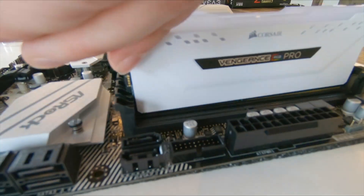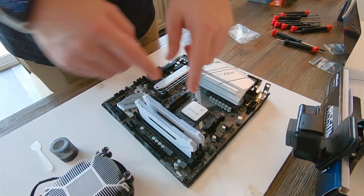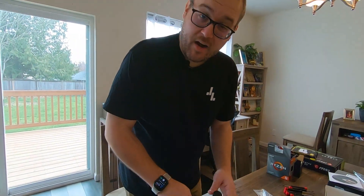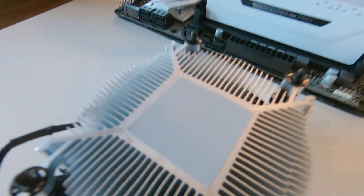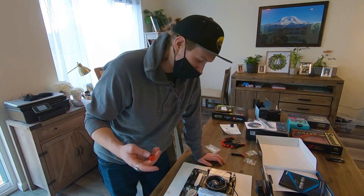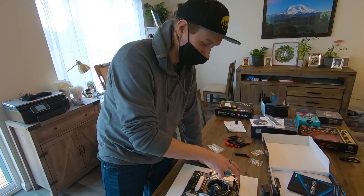The first thing we have to do is remove these two motherboard guards that line up with the screws on our heat sink. Then we're going to apply a little extra thermal paste — this cooler comes with a factory-applied layer, but we never trust that tiny little layer, so we have some high-end thermal grease here. We'll grease up the chip itself and then apply the heat sink. It's pretty straightforward; Gabriel will probably hesitate to push it down into the motherboard as hard as it needs to be, but we'll coach him through it. When seating the cooling unit, you want to tighten it down evenly, distributing pressure around the unit as you tighten.